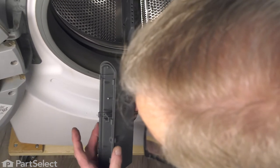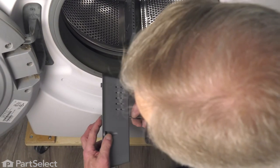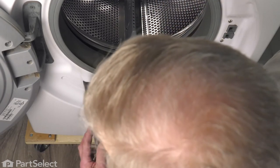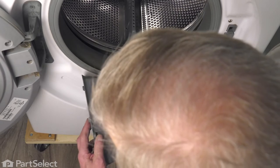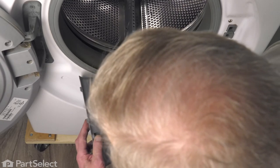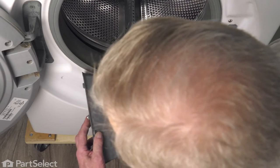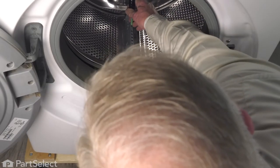The first thing we want to do is make sure that we don't drive the screwdriver in too far. We'll make a measurement roughly how far it has to go in, then just put a little bit of tape on your screwdriver shaft to mark it. Then locate that center hole.